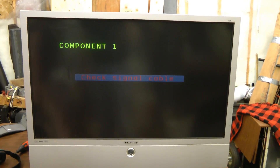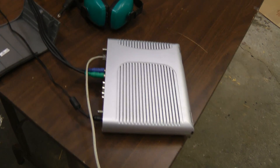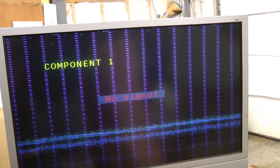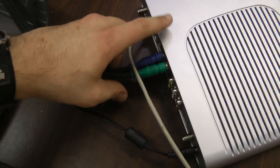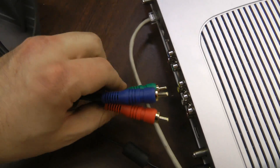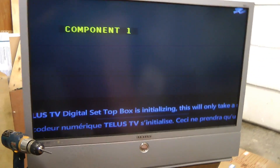Let's see if we're getting any display. Let's see if we can get a signal to this. It's hooked up to the IPTV box and it's not happy for some reason. Maybe the video standard is wrong — video sync, video rate. Let's just re-plug this into the composite output. That should give us a black and white picture. Yeah, there we go.